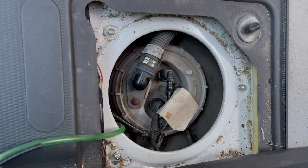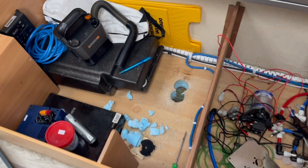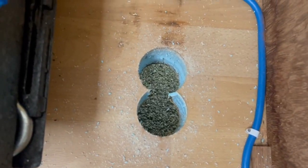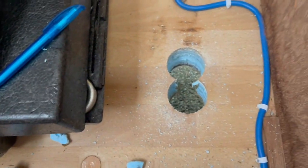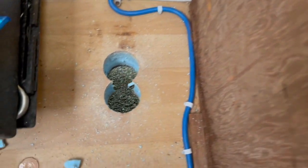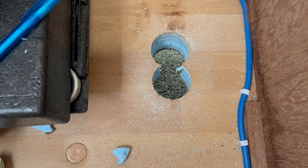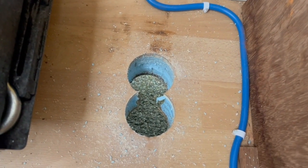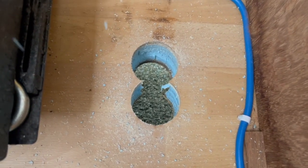That'll be the next stage. The holes are cut in the floor and they're plenty big enough - there won't be an issue with heat. It's all going to be sealed in place - that's where the diesel heater is going. The fuel tank is going to be in the gas locker, so it's perfectly safe. If it develops a leak it won't fill the interior with diesel. I'm hoping to run the trunking round through here, under the step with sufficient room, and connect into the original ducting so it blows out like the standard blower heating.